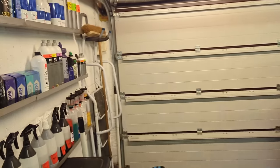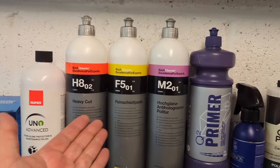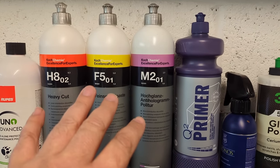The difference with machine polishers is the abrasives — pure abrasives — that are really designed to be used by a machine. You put them on, wipe them off, degrease, and in theory nothing is left behind. The main thing is when you're polishing by hand, you have to rely a little bit more on resins and fillers being in your hand polish.